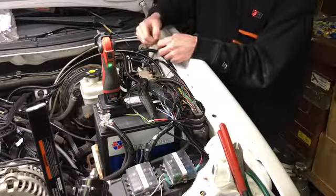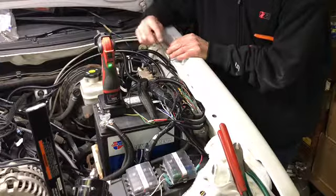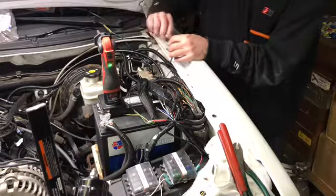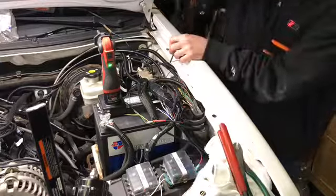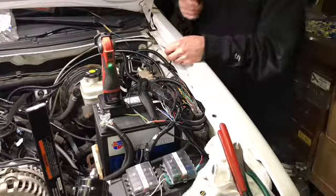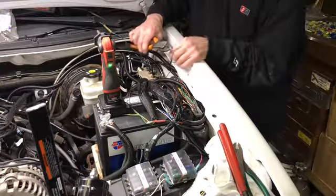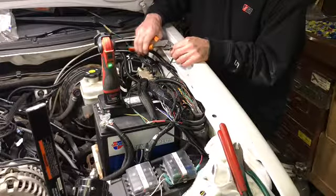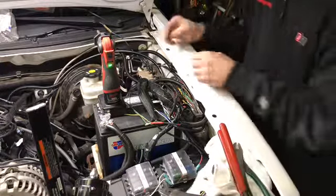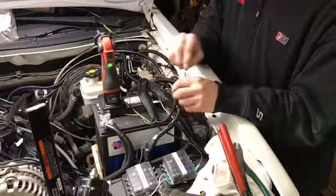Now, which you probably can't see, but these two wires, one's like a coated, silver-coated wire. And then the other one is just regular straight copper. And I'm putting them together. And whenever I do that, I don't think there would be a problem if I just straight crimped it. But just for safety's sake, after I crimp it, I'm gonna solder both of these connections just to ensure I have a good connection between the two different wires. So that's just me being over precautious, especially with connections and terminal crimping and everything.